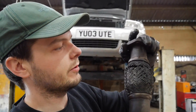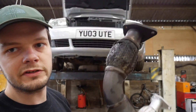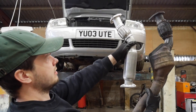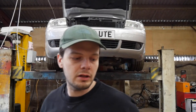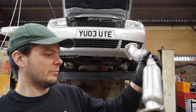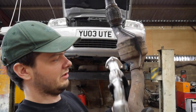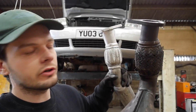So I got an advisory for this on the MOT last year, so I was always going to fix it, and then I bought the pipe straight away. But as we can see, the Audi is different. The end flange - they're the same. I even bought two new gaskets because I thought this would have a flange on it, but obviously it hasn't. So to reiterate: I'm going to bolt this to the car, cut just after there, try and tack it, then take it off the car and finish the weld. The flex is a bit smaller on this one but I'm sure it'll be fine.